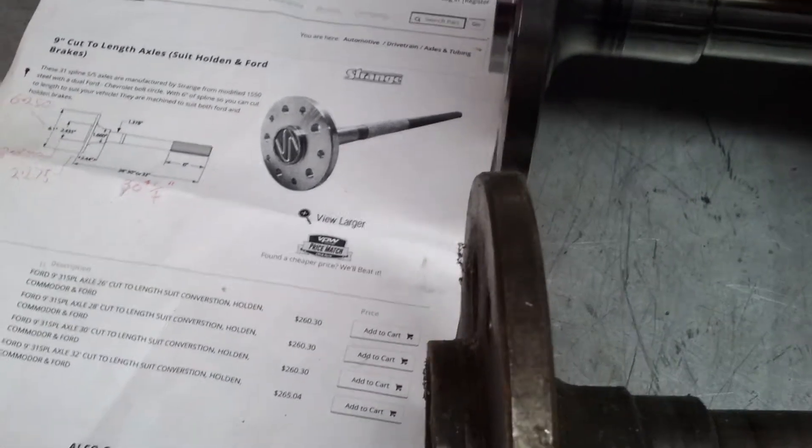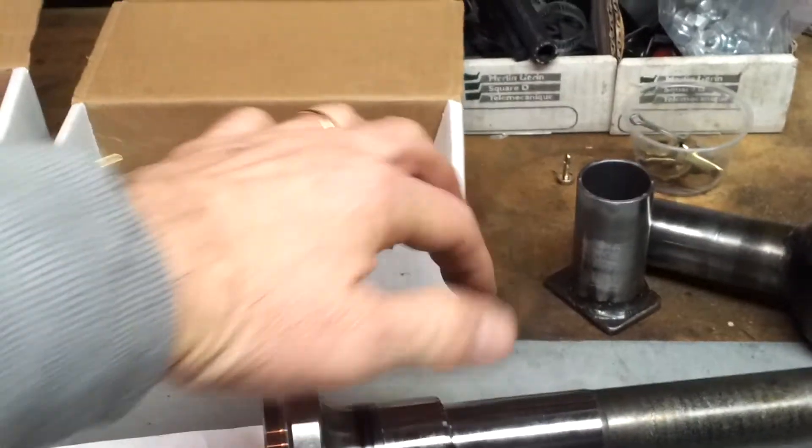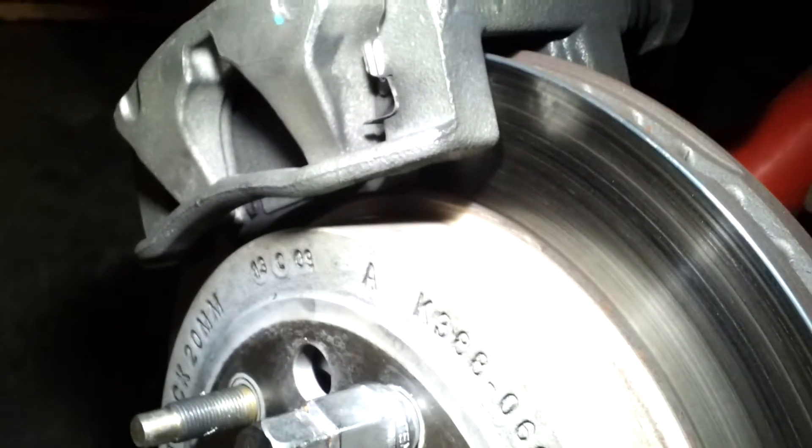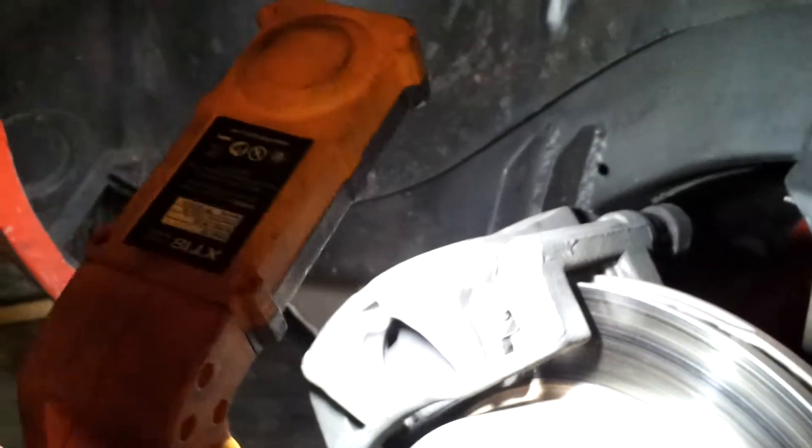The problem is the axle and flange is slightly thicker — but there's only 10 thou there, that's no worries. So it's just this distance between here and the bearing face that's going to put your brakes and your wheel 100 thou further out, which normally on a drum brake probably won't matter. But you can probably see the problem I'm going to run into: because I've welded the caliper bracket onto the diff, this distance is set. So there's no way that caliper is going to be in the centre of that rotor with an extra 100 thou on it. You can probably tolerate that on a stock style of floating pin caliper — 100 thou is probably nothing. That's 40 thou per mil, so I've only got 2.5 millimetres, but I try to get everything square that I can.